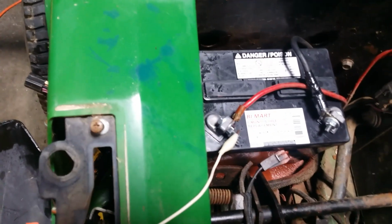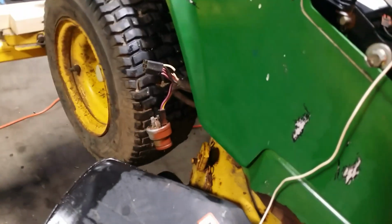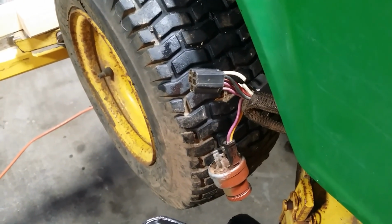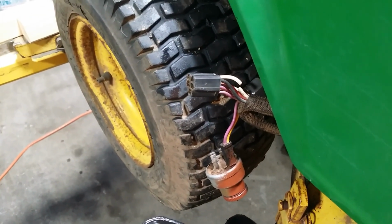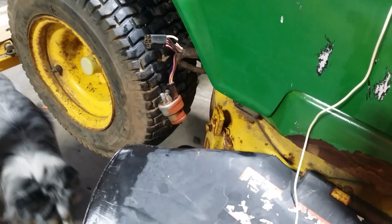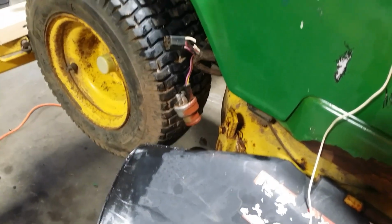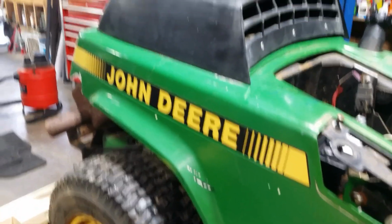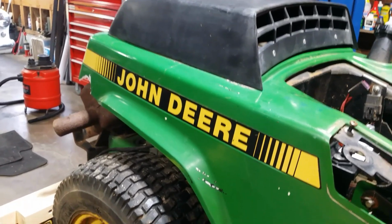All right, we got the new battery installed, and I did crank it over. Remember, that's the white wire we cut to unground the ignition. So that's certainly on the list to figure out why it's grounded. Got to trace it all out. Yesterday, because I thought the starter sounded bad, I oiled it. Guess it's got a clutch in it. It didn't really like that oil too good. It'll get over it eventually, but it takes a little bit to get it to crank over.